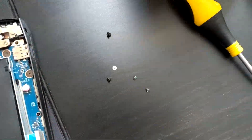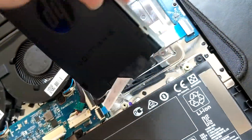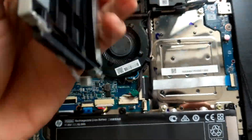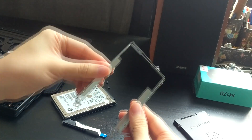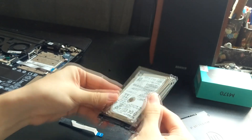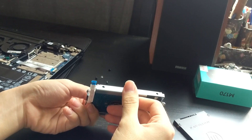Moving on to the hard disk bay — this is a dummy hard drive. There are three screws on the side of the tray; unscrew them and the tray simply pops out. Make sure to also unplug the cables before fully removing it. Here's the little piece of plastic pretending to be a hard drive. I'm going to install a one terabyte hard disk, a new set of HyperX RAM, and the original SSD. To install, take out the plastic dummy, put the real hard disk into the tray, screw it in, and reconnect it to the motherboard with the ribbon cable.